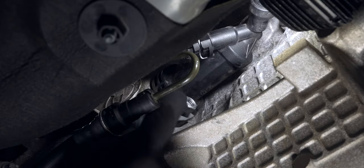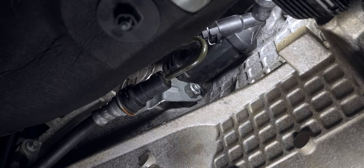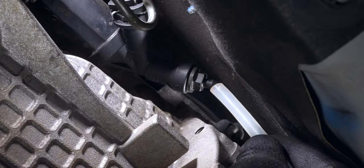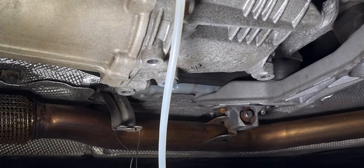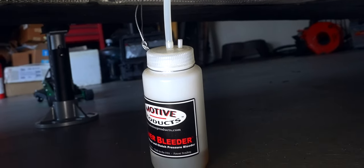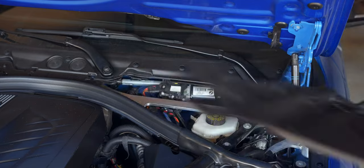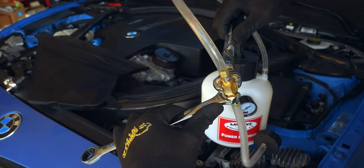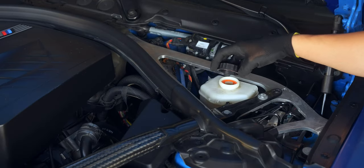Now clean up your clutch line and attach it back to the slave cylinder and unhook your pliers. You can secure it with the 13-millimeter nut. To bleed the line, remove the cover on the bleeder valve and attach your catch bottle. Moving over to the brake reservoir located underneath the driver-side cowl, held in by three 10-millimeters and a push rivet. Set up your power bleeder by connecting the lines. Adding some pre-twist to the adapter will help prevent the line from kinking when it's snug onto the reservoir.